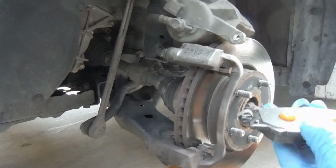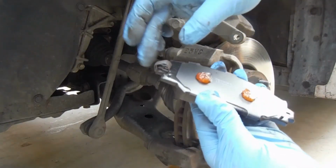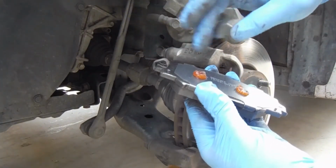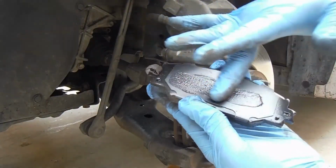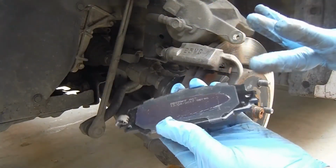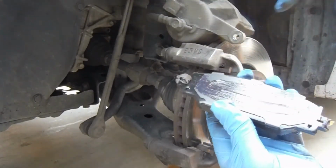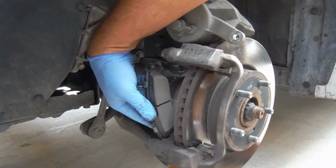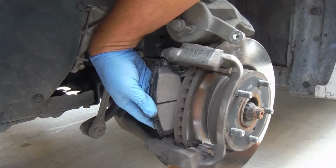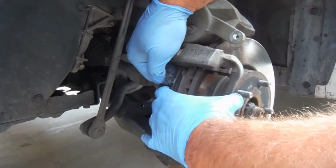on there. And before I put the new brake pads on, well, this little noisemaker came in the kit. We had to attach that. And then I just put a couple little dabs of this Sil Glyde brake lube or brake grease. And if you put that along the backing plate and at the ends where this will go into the little retaining clips here, seems to keep it a little quieter.